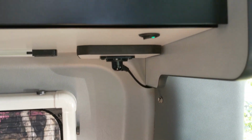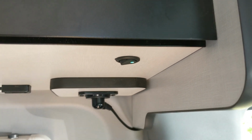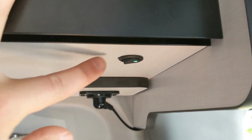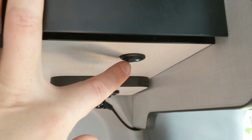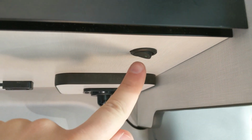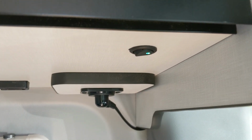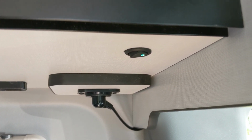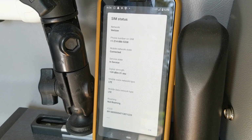I also added, just because I didn't want to leave the WeBoost on all the time for the sake of conserving electricity, this switch, which I just drilled a hole into the bottom of the cabinet, stuck it in, and then ran the power through this switch. So you can see the WeBoost is on, and then I can just flip it off, and it's got this nice little LED. And so that way I don't have to go into the cabinet and manually plug and unplug the power from the booster itself. So that's pretty handy. And I'll link to these switches on Amazon in the description below.